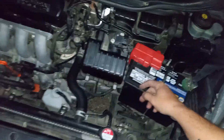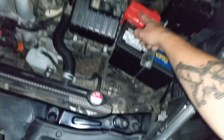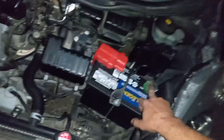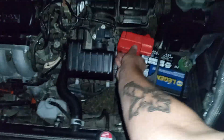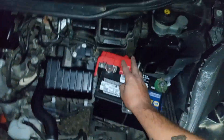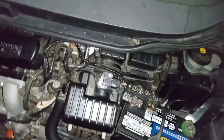Pop up the positive terminal, and I would recommend taking off this bolt which releases the bolt from the positive terminal, because you are turning a wrench and the main fuse to your whole car is right here, and a bunch of fuses are right here too — so you don't want to be torquing a wrench on that. Don't torque it on top of these leads because if you do that with pliers it'll snap the top right off. Take it off the car first. When you're putting this on, take this bolt off and slide these off so all these fuses can go away in the back when you're working on it, because you don't want to break all this plastic.